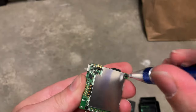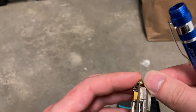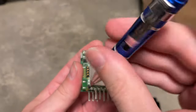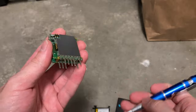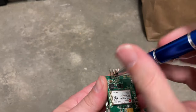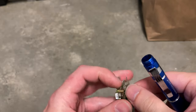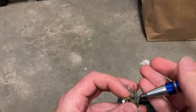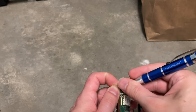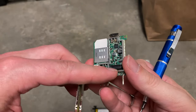I'm going to use this tiny screwdriver to unscrew these tiny X-head screws. It's a star bit of some kind — Star 2 maybe. It's real small. I'm flabbergasted that this little kit contains the correct X-bit. Once we have that undone, we'll go to the other side and unscrew the other two. There we have it — there's a push-fit multi-pin connector in here, and there's a SIM card.